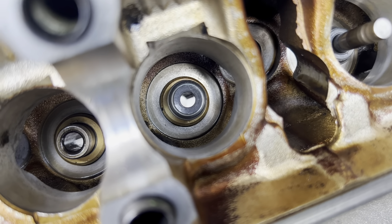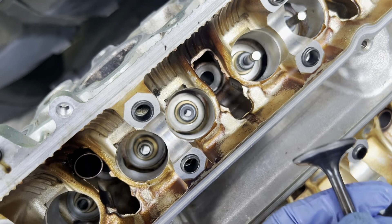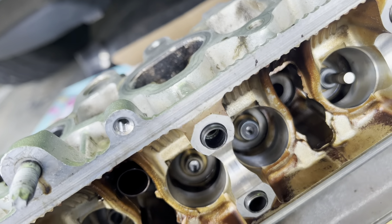Now that the valve stem seal is installed, we're going to reinstall our valve. You have to be careful when you reinstall the valve because you don't want the stem to knock that seal off. Also, the reason I do valves one at a time and install them that way is so I don't mix them up — the last thing I want is to lap it to that seat and then move that valve to a different seat. There might be small differences that make things not work out right. So try to keep everything together and as uniform as possible. That's basically the best way I know to lap a valve and make everything fit and work. I've never had a problem doing it that way.